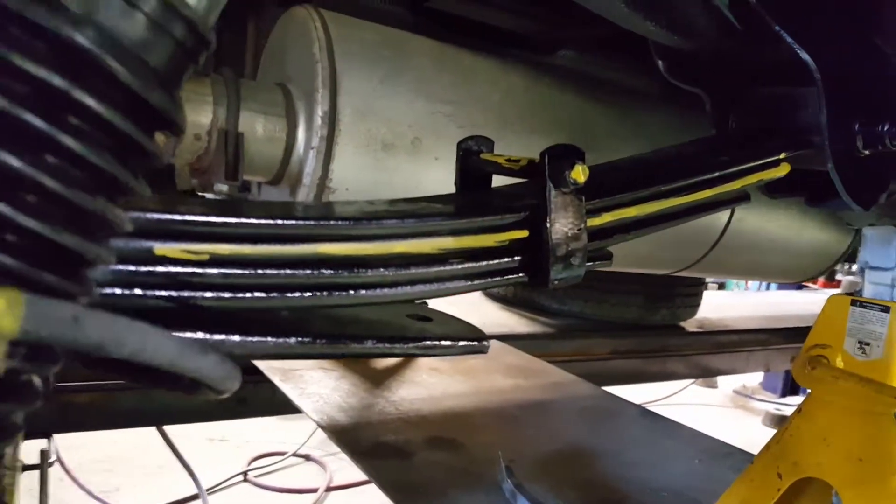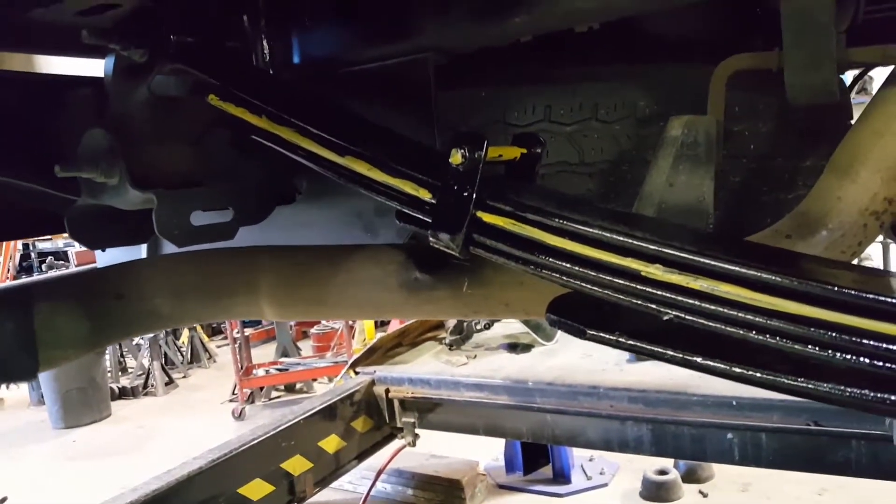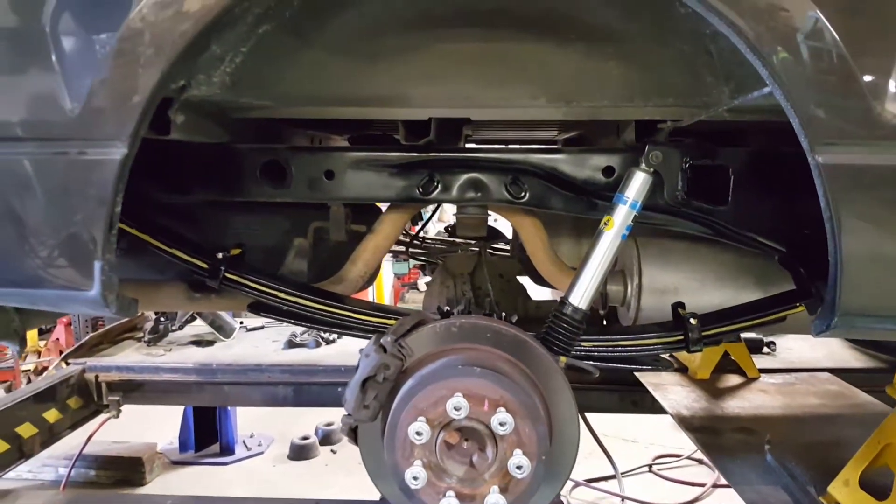You're going to get a better ride out of that — it's not going to be as stiff. So make those spring clips longer. If you're not making them longer, you're just going to get a stiff ride. And then put a better shock on there for better stability.